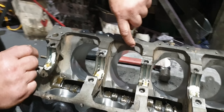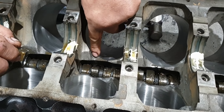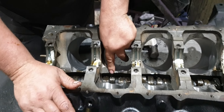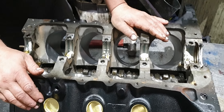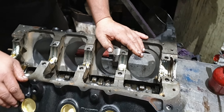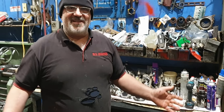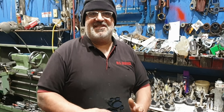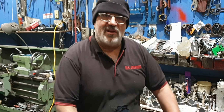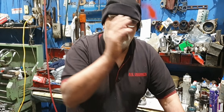So I don't have to sit there and cut this one out. Have a look - this is already cast. See that cast mark there where the conrod misses? And on the bottom of the bore? So you don't have to relieve this - that's the beauty of it. I've actually got another block down there I can show you the difference. But this is actually a genuine stroker block. They put them in everything. Too much trouble to cast a specific hundred stroker blocks when the rest of the 600,000 they're doing normal - they just cast a whole lot in one run. Made no difference to them.